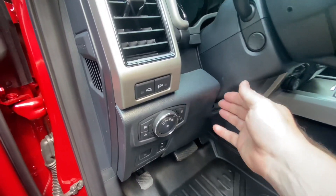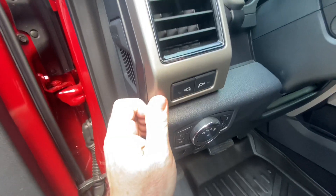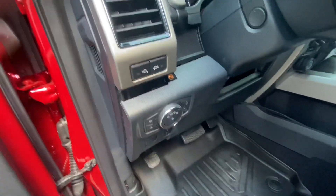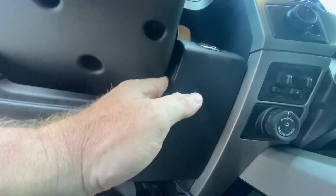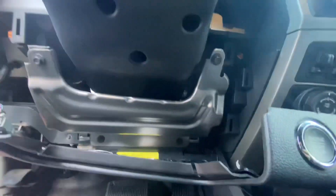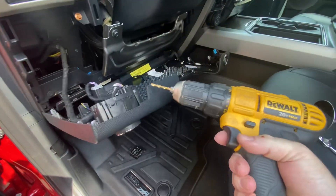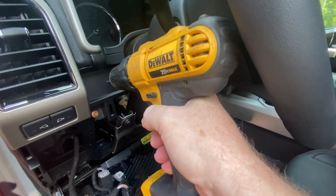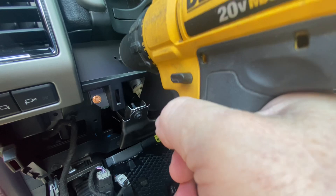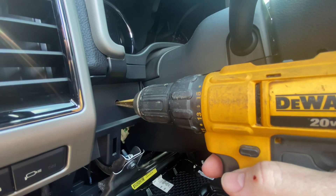Because I'm installing my switch and potentiometer in the dash, I have to remove the lower trim panel from beneath the steering wheel. Just grab it on these corners and pull and it will start to open up. Be careful, just go slow and these things will pop right out. I'm installing my control just to the left of the steering wheel. I used an eighth inch drill bit and a drill motor to drill a pilot hole. The location of this hole is very critical and I'll show you later why. I used a unibit to enlarge the size of the hole to the same as the shaft for the potentiometer. Be careful, don't enlarge the hole too big.